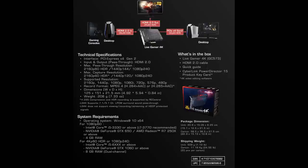Getting into the technical details: this card is internal, so it fits into a PCIe x4 slot on your motherboard — though it can also go into an x16 slot. The maximum pass-through resolution via HDMI 2.0 is 2160p at 60fps HDR, 1440p at 144Hz, and 1080p at 240fps.